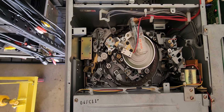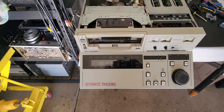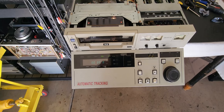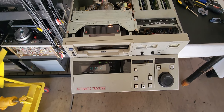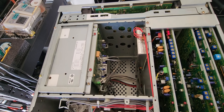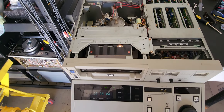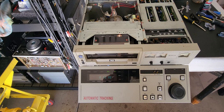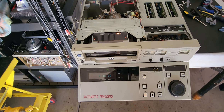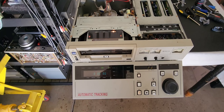I'm gonna have to talk to the owner. Mechanism-wise, the restoration is complete — it's completely repaired. But it does need a card. There's a bad card somewhere — either the servo card or possibly the video output/video head card. It's coming up with an error code, not engaging for playback, no video, no audio. I had squiggly lines on the monitor a little while ago, which generally means a bad IC or bad card. I hope you guys enjoyed this video.